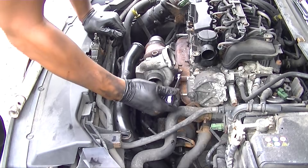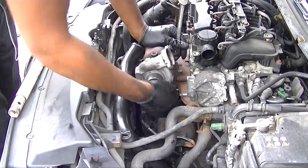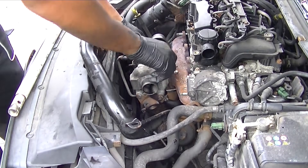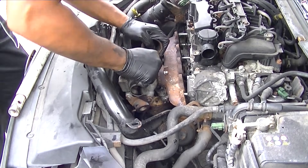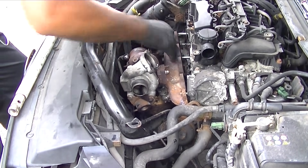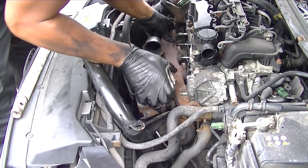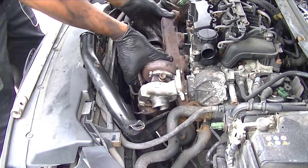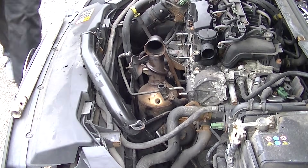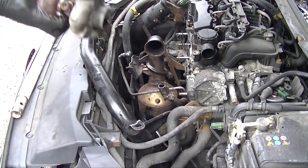The total project took me about 40 minutes to remove and should take about the same to put back on. Remember you have to clean all the pipes — all of the boost pipes — before you replace with a new turbo. It's a bit of a fight but it does come off. There we go — the turbo has been removed! Hope you liked the video, comment, rate and subscribe. I'll be showing the installation shortly, thanks for watching.